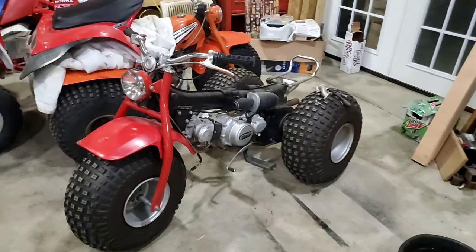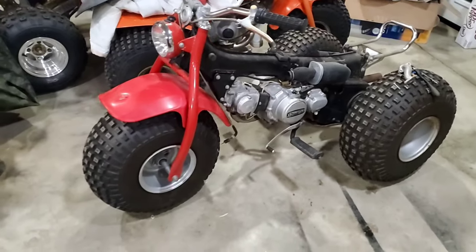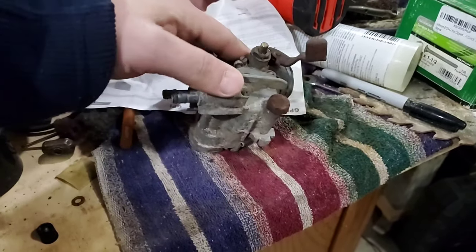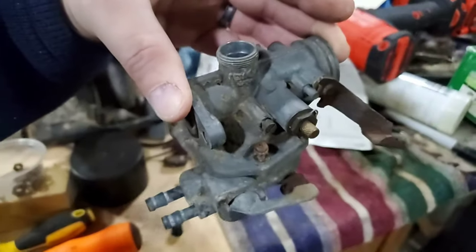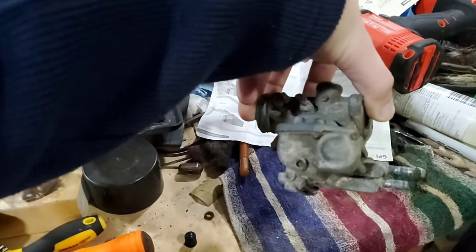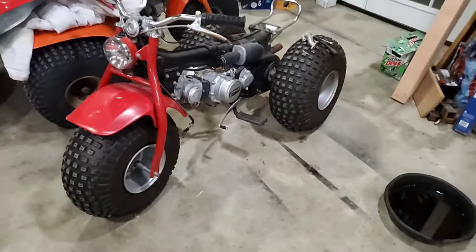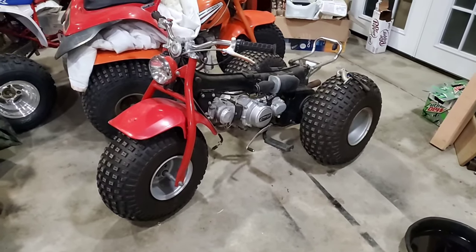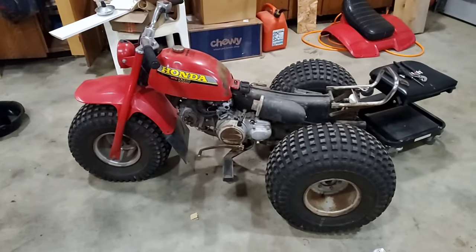This thing is also getting some attention. This carburetor didn't make sense to me, because this chassis, this machine looks pretty clean. But the carburetor I pulled yesterday morning, and the carb lever is stuck in place. You've got corrosion on surfaces that the condition doesn't match. The condition does not match that of the chassis. So I think I'm gonna look for a different option. I've spoke to Mr. Mike Pongren about this, and I think I'm gonna place an order with him later today and give him the results of this little exercise that we went through.